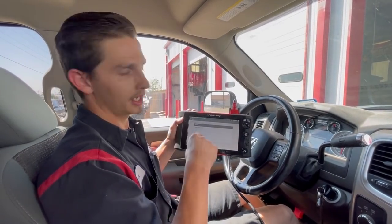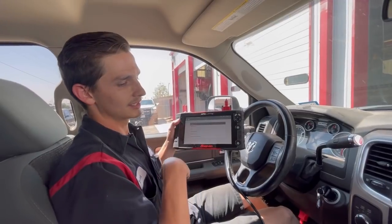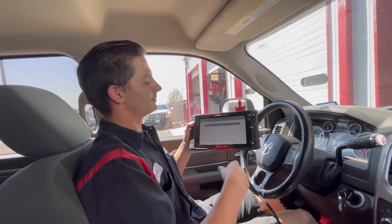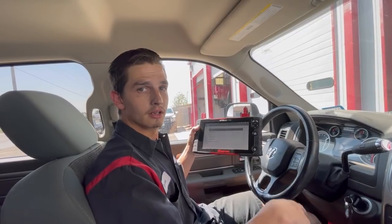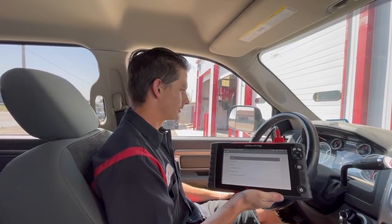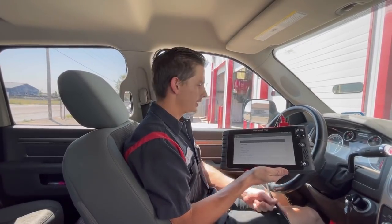What we're going to do today is a quick learn. What it does is reset the CVIs in the clutch pack. We're going to drive at low RPMs, make it shift a couple times, stop, repeat — get about 50 to 60 miles on it. If it works correctly, we'll deliver it to the customer. This is pretty much a stock truck with an upgraded Jasper unit.